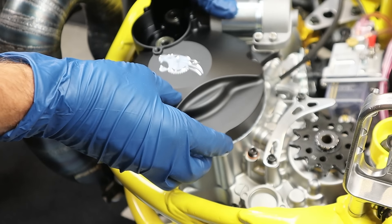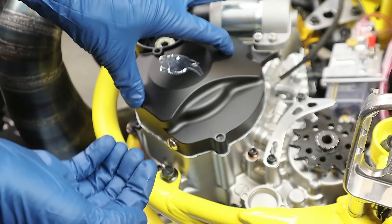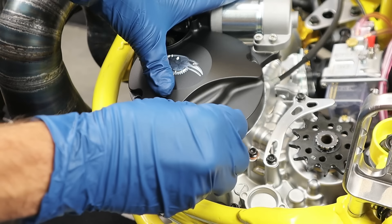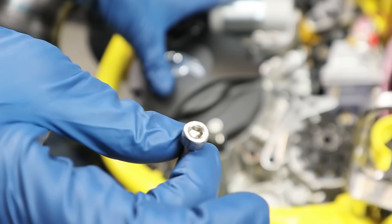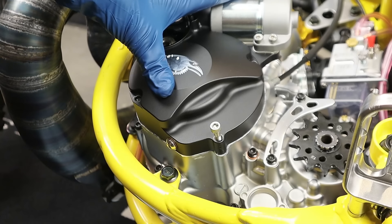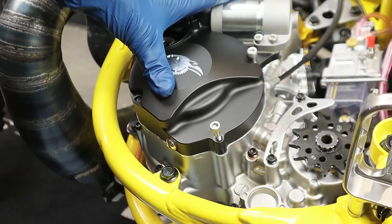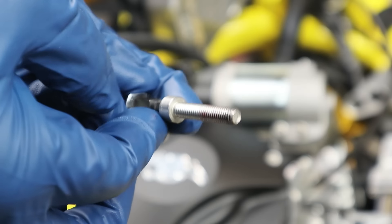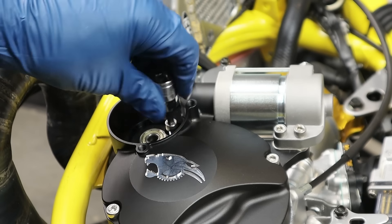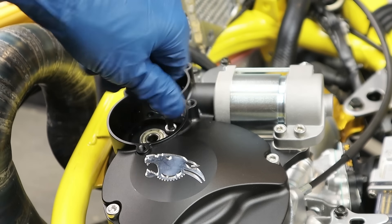This gear will rest here on the end of this fastener. Also notice the breather elbow on the back of this cover — that'll come into play later with the breather hose we saw earlier in the video. Going to drop this thing on and try to make sure all my cover holes are lined up with the engine, because I don't want to spin this thing with the 1211 wet if I can avoid it. Panthera is going to send you four Allen-head screws to affix this cover — the shortest one goes up top behind the gear door.